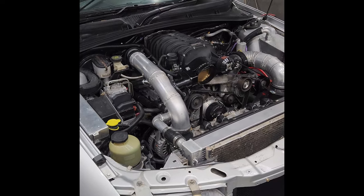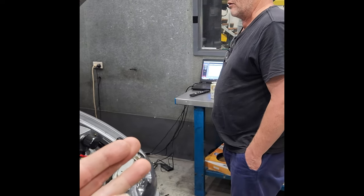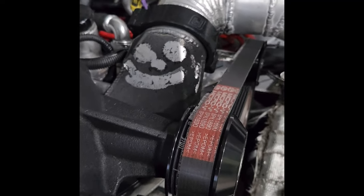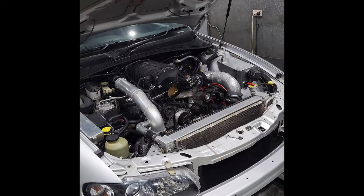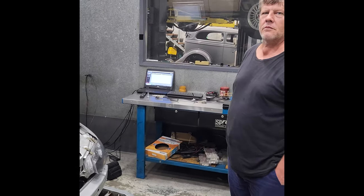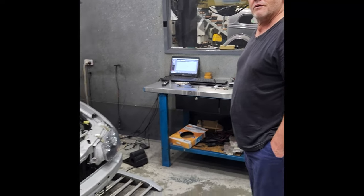I've just got to work a few little issues out. New spark plugs and new leads would have been nice. So the to-do list: new spark plugs, new leads, a few little wiring fixes, belt alignment, and more ribs on the belt — she was having a bit of belt slip there. Belt dust is just from normal use for you, yeah. If you had the choice of buying a Whipple or a TVS, and someone was actually having to engineer a kit — I'll take a TVS anyway. Hands down, TVS. Proof in the pudding. Tuna says so.